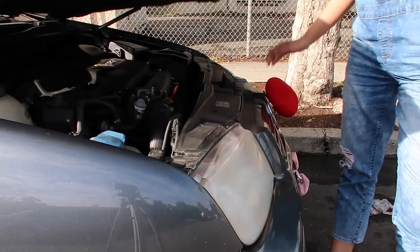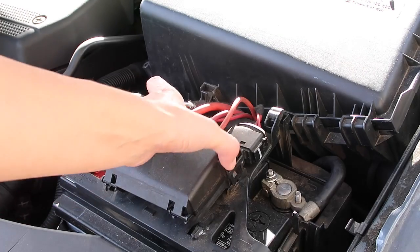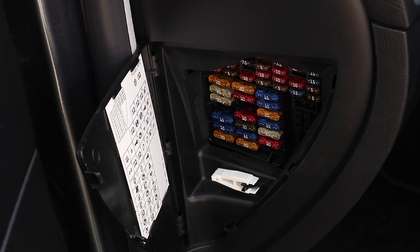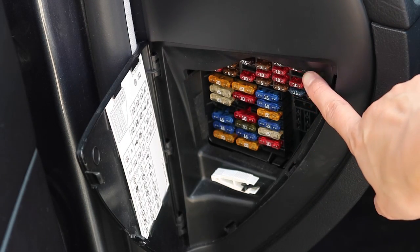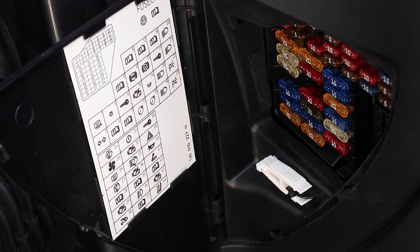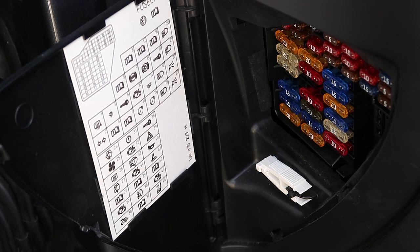Checking a fuse is super simple and I'm going to show you how. Most cars have at least two fuse boxes — my car actually has three. I have two under the hood that control things like the cooling fans and the engine control unit, and then I have one inside the vehicle that controls things like the radio, the sunroof, the power windows, headlights, turn signals, etc. You'll want to check your owner's manual or do a search online to see where your fuse boxes are located. Simply open up the panel and you'll see all of the colorful fuses. You'll also see a map that tells you which fuse corresponds to which component in the car. You'll want to check your owner's manual for clarification on this map, but more or less it gives you a good sense of which fuse goes with which part.